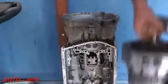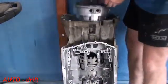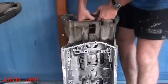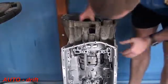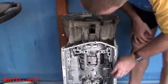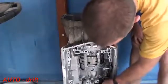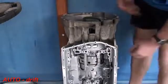When I lift this up and put it in, I'm going to look at these oil pump holes and also the bolt holes as I lower everything down and make sure everything is aligned correctly. Also, you can see from here what I'm trying to do is actually have these slots here align with those. So that'll make that a little bit easier. If I actually move that into park, it'll lock the bottom gear so they can't actually turn, and that'll make things a little bit easier.